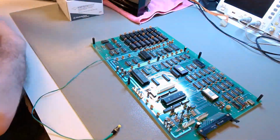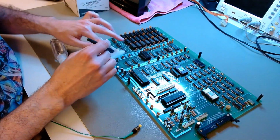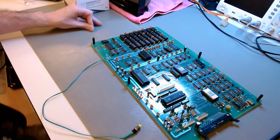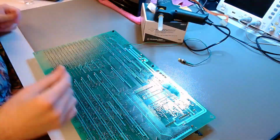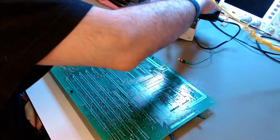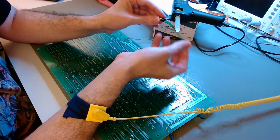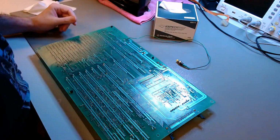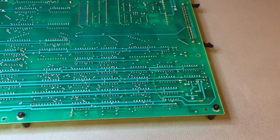First, I'm using this reset button, although it's a modification, because it has a conservational aspect. It prevents the need to power cycle the machine all the time, which can be stressful for the ICs. But I'm soldering it now from the back of the PCB, so it doesn't change the visual aspect of the PCB, and I'm also going to put it in an existing original hole in the case, not a drilled out hole. I'm also adding some glue there for strain relief.